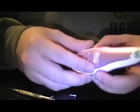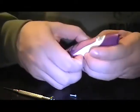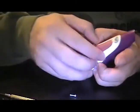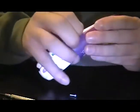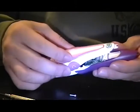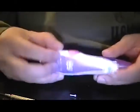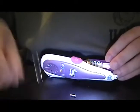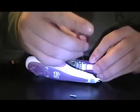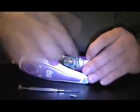Once you take that out, flip over the tag and gently pry open the top of the tag. You will see there are two small pins holding it. Try to gently pry it open and then slide it back — that will reveal two more screws holding the base of the tag. Remove those and then you can remove the base by simply sliding it forward.